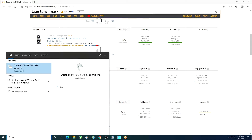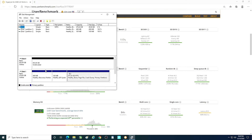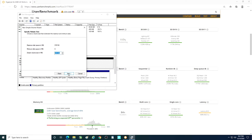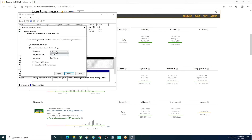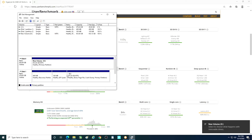So what you've got to do is format this sucker. You see there, it's unallocated, so nothing is recognizing it. The first time you go in here, it'll give you a message — this time it did not. So we're going to create a new simple volume, and it's going to be letter D. We'll take that default, finish — boom. Now we have a drive in here.